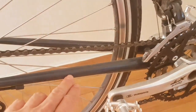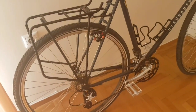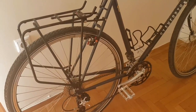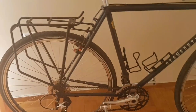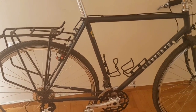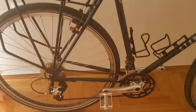Another thing here is the chain stay — this is slightly longer. So we've got a longer top tube and a longer chain stay, and what that means is that with more room on the bike, when your foot is on the pedal it's not going to hit a bag which hangs down on this section. If you're on a bike that's not been designed very well, on the back pedal you could catch your bags — which on a bike tour is going to be quite annoying after a while. That's basically the fundamental difference between this design and a road bike: firstly it's a steel frame, and secondly it's the geometry — it gives you that little bit of extra room so you don't catch the bags as you're cycling.